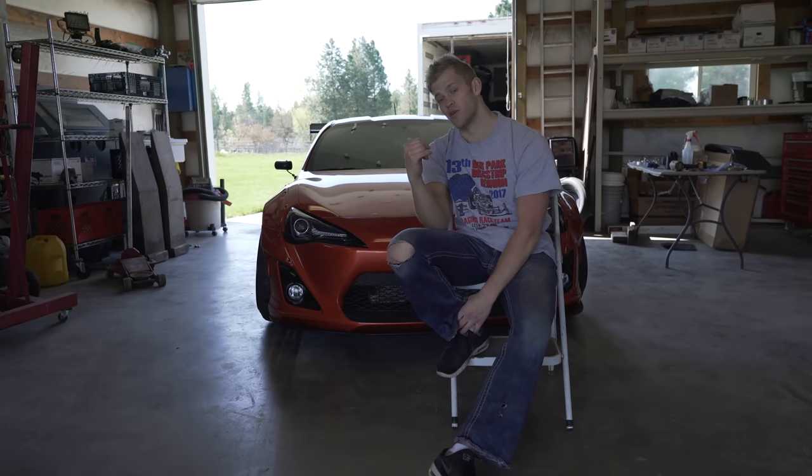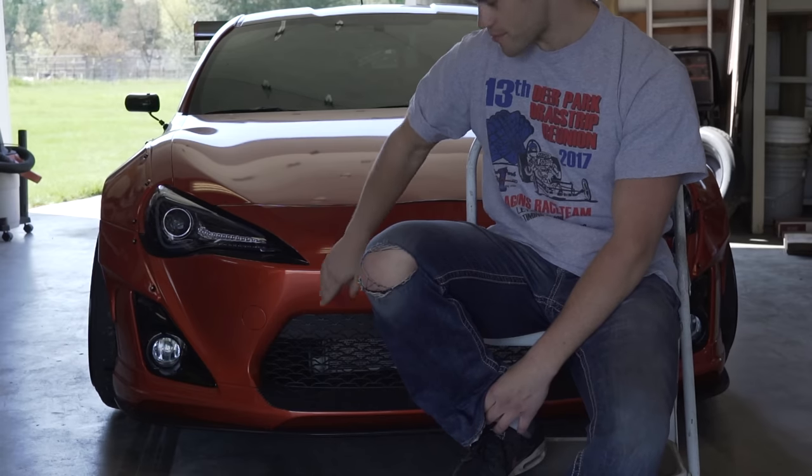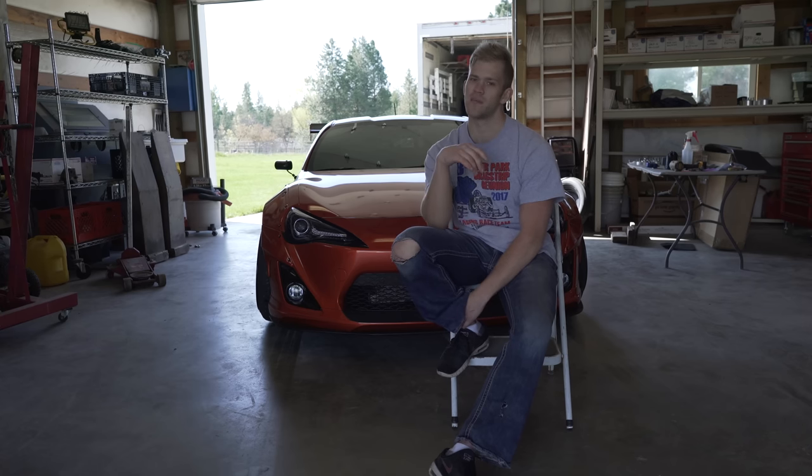Alright, let's get to work on some cars. So what we're going to be doing on this FRS behind me — the lift kit's all aired up right now — I need to do a quick alignment on it. I just got the toe straightened out because I added a bunch more camber up front, as you guys saw in yesterday's video. I'm going to do that alignment with just string. I've already made a few videos on this, so I'm just going to time-lapse it today.